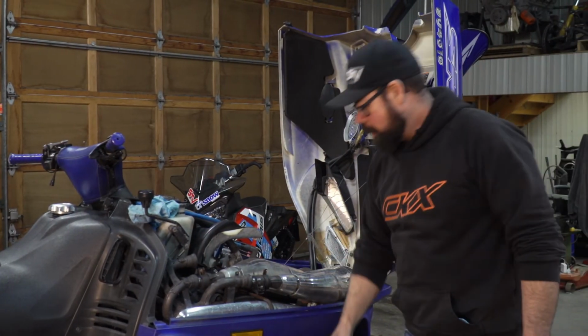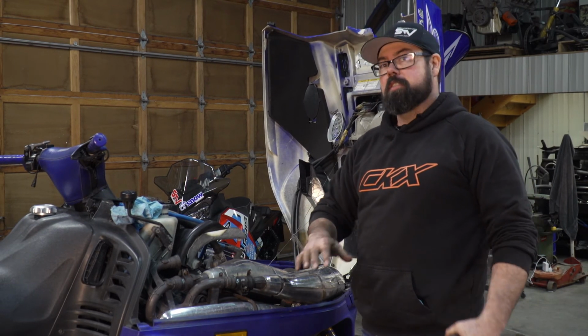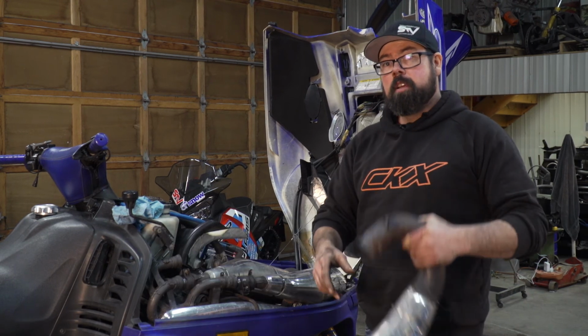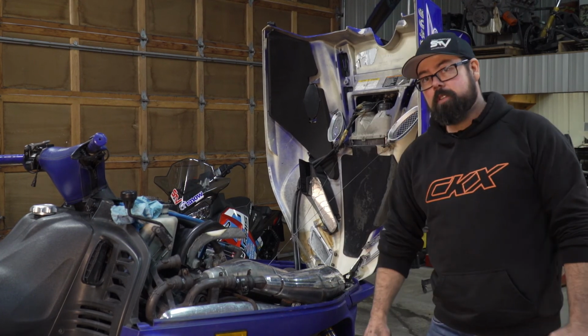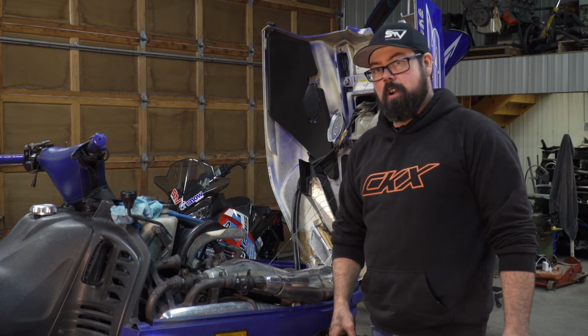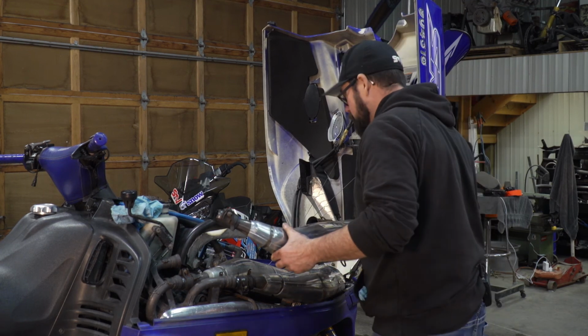All right, there we go. All the suspension's back together and it feels a lot better than it used to. Hopefully all the dartiness that we were getting out of this machine is going to be completely gone. But before it hits the snow, obviously I got to get the pipes back in, but I also need to check to make sure that the camber is correct and that my toe out on the skis is correct, but that'll be for another episode. Now, figure these things out.